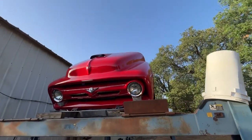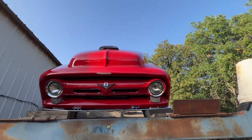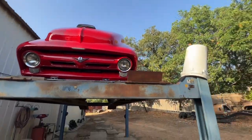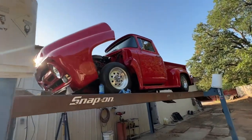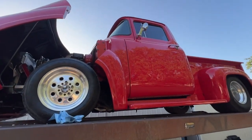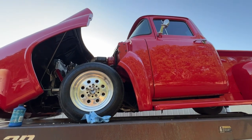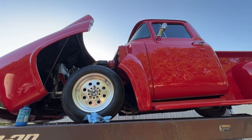If not, I know guys that will glue them on there, but I wouldn't do that because you need to be able to access the inside of the door panels for glass, door runs, locks, things like that. And once you get those things on there, you can't get them off. So again, for us, I would maybe look for a different solution. Maybe one, you can sometimes tap the latch within the center hole and put a machine screw in it, with a different kind of handle on there.